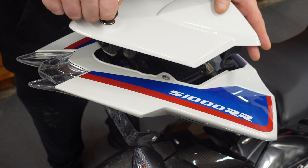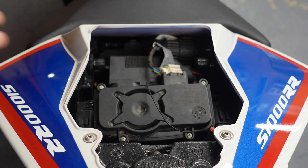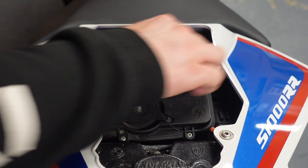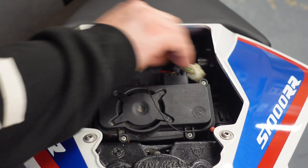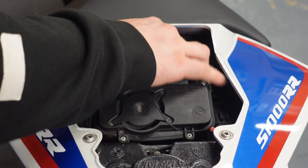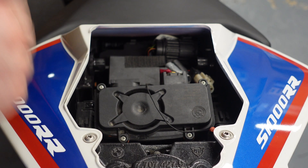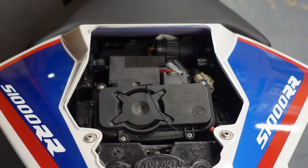I'm gonna show you what we're gonna be looking for next. If you look into the rear seat area here, you're gonna have your META alarm, which is the BMW alarm now — they joined forces with META to fit these. That's not what we're gaining access to. You can see all your plug connectors, which are for your fuses and your rear tail lights. BMW put a sensor on everything, so if there's a fault anywhere on the rear lights or indicators it will come up on the dash. But our main focus today is gonna be the OBD.